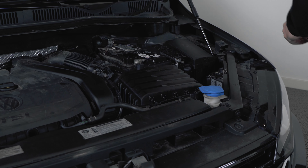Once you've found your battery, you can find some valuable information on it. What you need to know is the battery chemistry — whether it's a type of lead-acid battery or a lithium battery — and its size, which is measured in amp-hours. Now you need to pick a charger that works for that chemistry and size. In this case, we're using the MXS 5.0.